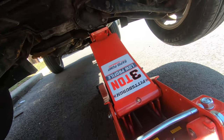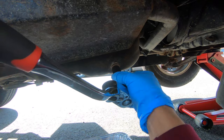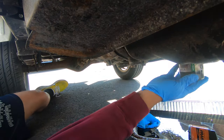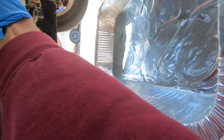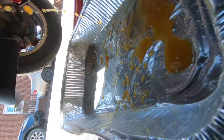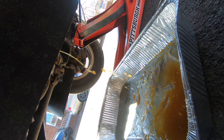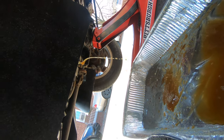Laziness always wins, but I might as well use the jack since I paid for it. First, let's do the oil since that might be the most annoying part. Coolant is really just one-two-three. Moment of truth to see if this M1-103A filter fits. Oil filter is on - not sure if it'll leak yet. Now draining the oil - just pull this out and turn it. The oil is pretty dirty. I flushed it like seven times when I first bought the truck and it's the same exact color, which is pretty annoying. After this, I'll put distilled water through two times for the coolant.